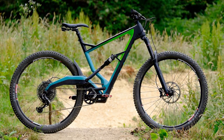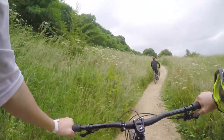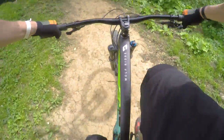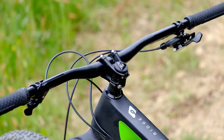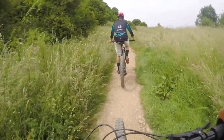So when you're riding steep terrain, you're kind of hunched over to keep the front wheel from lifting because the seat angle is so slack. Overall, it's a really uncomfortable and awkward bike to ride up steep and technical terrain when you're seated. When you're pedaling stood up on smoother terrain, it does have that huge advantage of almost no pedal bob, so almost all of your energy is going straight to the back wheel. But I did find that because the reach is fairly short on this bike — 475mm in the XL — the bars were a bit close, so it's not a particularly comfortable position even when you stood up.